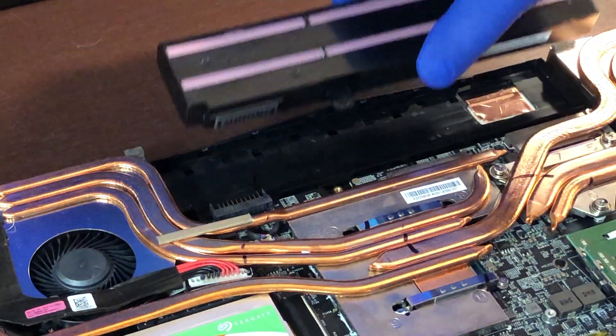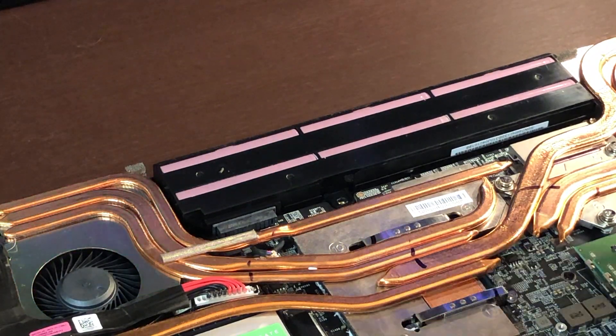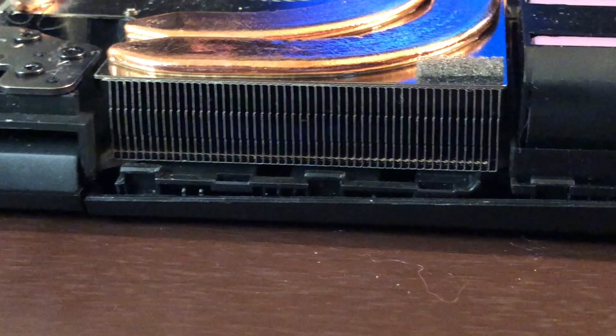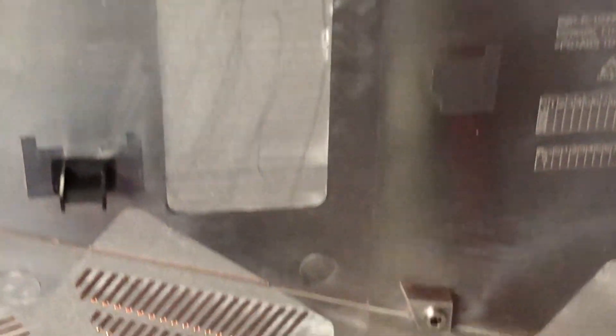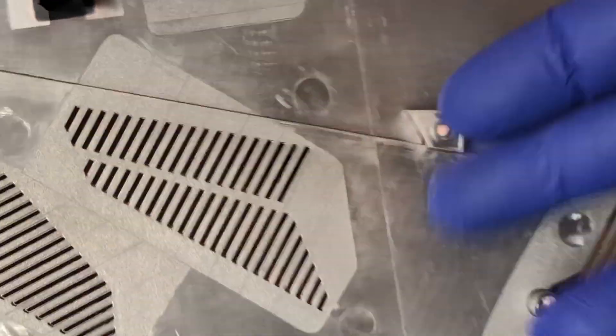When you are finished, reinstall the battery and don't forget the screw. Here is an overview of the two drives installed. You can now reassemble on your own or continue watching the video. Upon opening the laptop again, it took me just over 10 minutes including removing and replacing the screws. The small plastic piece I removed in the upcoming video didn't have to be removed at all. The bottom panel is in fact plastic and is sprayed to look like metal, or it could be some type of coating to stop interference — I'm just guessing because I have no idea whatsoever.